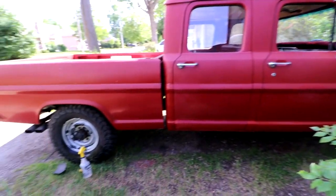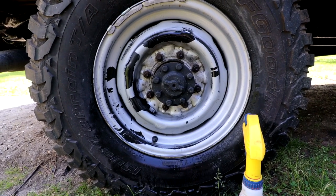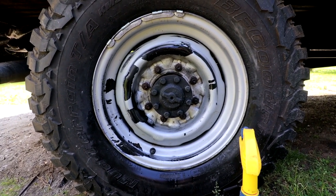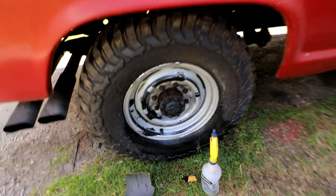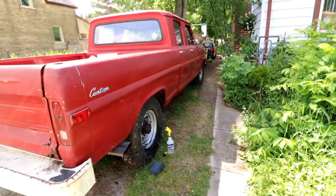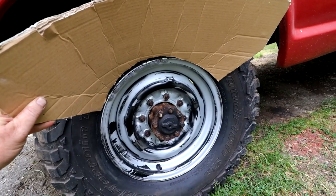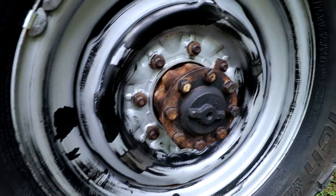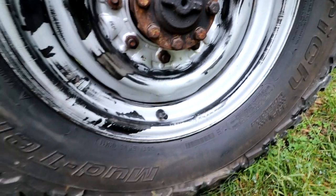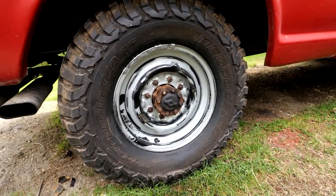My next job on the truck is an exciting one visually — I am sanding the wheels and wet sanding them, getting the silver paint smoothed out with the black paint underneath, and then I'll be painting them gloss black. I think that'll look really good. I've got the first wheel rubbed down and I've got a mask to spray paint with that'll mask off the tire. It was hard getting into all these spaces around the bolts, but I went in with the degreaser, got it all cleaned out, sanded down the lips best I could, and degreased them all. Here's the reveal — the rear tire is painted black, turned out pretty good.